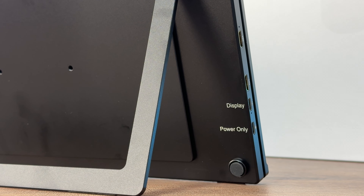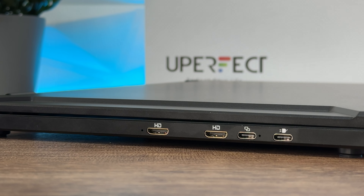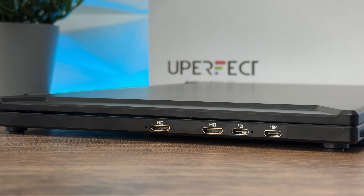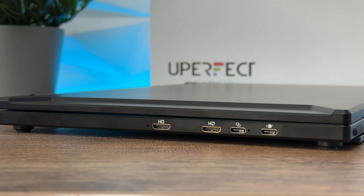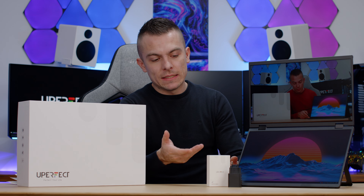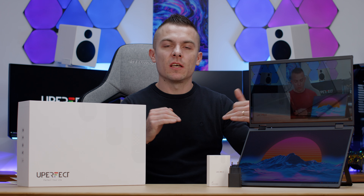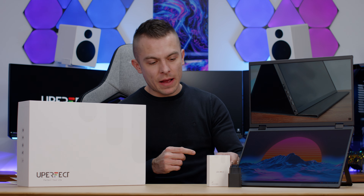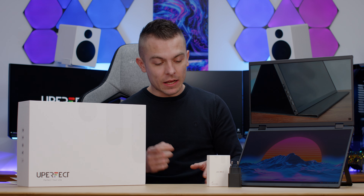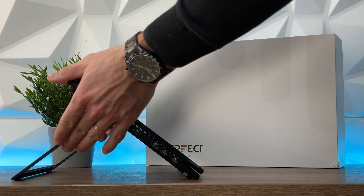With only one cable, if you wish to connect multiple devices to it — specifically this version — you have loads of ports and multiple versions of this monitor you can connect. My current version has two HDMIs and one Type-C connection for the multiple display showing, plus another Type-C for charging because you do get a wall charger included. I think it's more designed to connect two completely different laptops, MacBooks, or PCs via the two HDMIs — but currently I'm running HDMI and one Type-C for power.